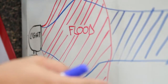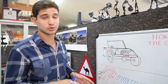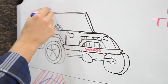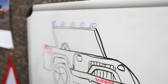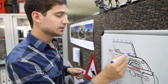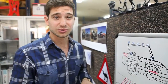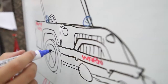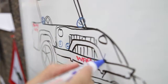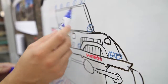If you're a professional, you actually want to use a combination between the flood and the spot. I've drawn a sketch to show you where to place spotlights and where to place floodlights. Spotlights are usually installed on the top of the vehicle so lights are as high as possible and can give you the longest distance possible. You also have the choice to place lights by the windshield — that's where you also want spot lights, because flood lights there would reflect on the hood and bother your driving. The bumper is the area where you want to put the flood lights, because it's at the front and relatively low, giving you coverage of the area around the car.